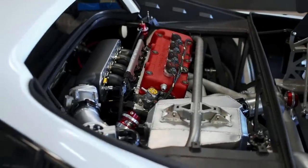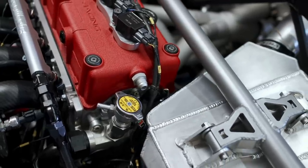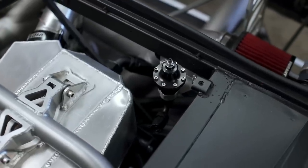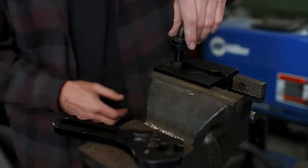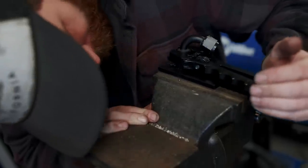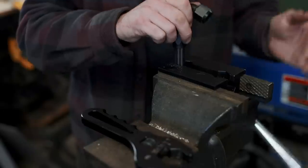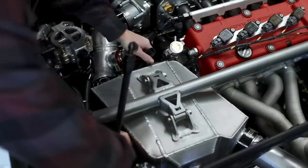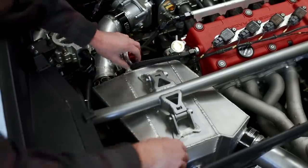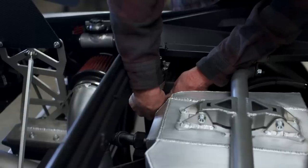On the subject of breathers, ports, and hoses — there's one component in the engine bay I didn't finish for SEMA. Some keen eyes asked about an open AN fitting on the valve cover, or the small black thing in the corner of the engine bay. That's an unfinished vacuum regulator setup. When I ran out of Dash-8 AN hose just hours before leaving for SEMA, I knew I had to leave it undone. The car can run without it, but to have a completely finished system we need to build one final hose connecting the valve cover port to the regulator. Due to spatial constraints it does cross over the top of the intercooler, but overall it should give us perfect control over the crankcase vacuum.